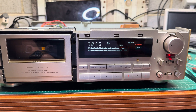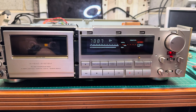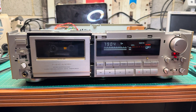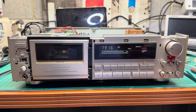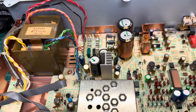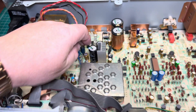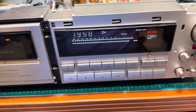I'm not sure what else to do. I validated all connectors, all wires - everything is soldered well. There are no other issues with this deck but this sporadic flickering. Sometimes it can work for days without flickering, sometimes it does it for a couple hours in a row and then stops. It's maybe CPU aging. I replaced almost all capacitors on the power supply, and just six big ones are left which I didn't replace. Touching them doesn't change anything.